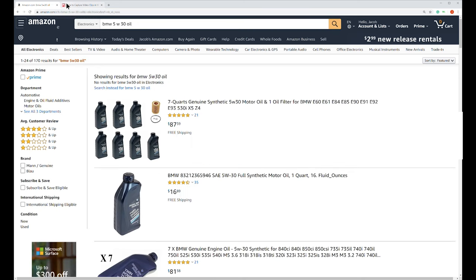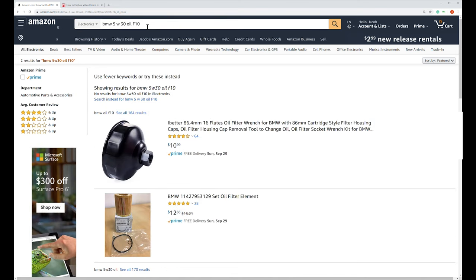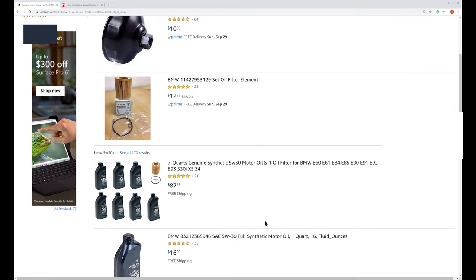First let's talk about the supplies, parts, and tools you're going to need. To accomplish this oil change on this engine we need about 5.3 quarts of 5W-30 engine oil — I'll put a link in the description below, I got mine off Amazon. You'll need an oil filter kit that will come with about two o-rings and a crush washer. I didn't use a crush washer because on my drain plug it doesn't need one — it's actually plastic, so it's a different style.